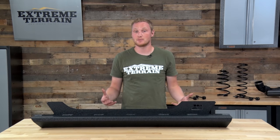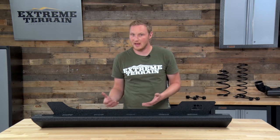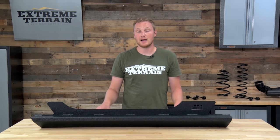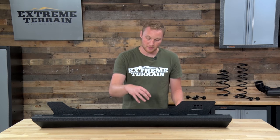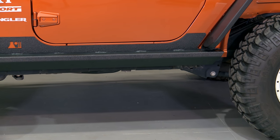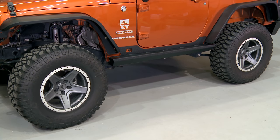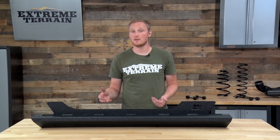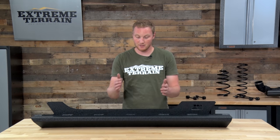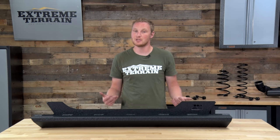As I mentioned, these are going to be a lot more expensive than a lot of other rock sliders on the market. But I think they're still a pretty good value. The way that these mount in two different spots — on the body bolts and on the pinch seam — means they're going to be very, very strong. These also provide a step, do a nice job of covering the pinch seam which otherwise looks unfinished, and all in all they're a really well-built, strong product that I personally like the looks of and the function of. If you don't have the budget for these, there are a lot of other options on the market — some that mount very similarly and are a little less expensive, and others that mount just on the body bolts or just on the pinch seam that will still offer some protection.